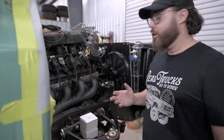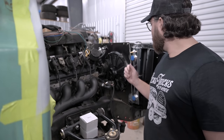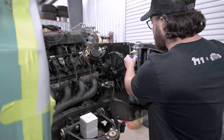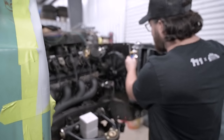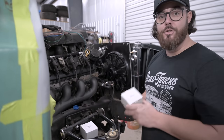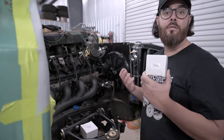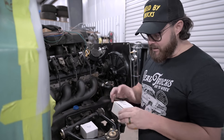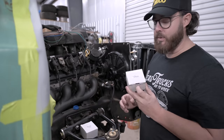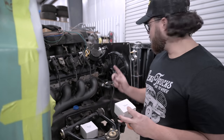So in the last video, when we were installing the cooling system for the truck and walking it over, we determined that behind these little blue plugs on this CJ Pony Parts radiator, there's a threaded bung. So essentially what we ended up having to do, because we didn't buy them in the first place, is go find some. Summit Racing, I live in Georgia, they can get stuff here overnight without any extra shipping, so that worked out really well. So what we did is we ended up getting these Frostbite LS swap radiator hose fittings for the top and bottom.